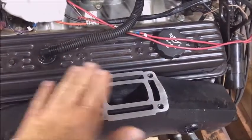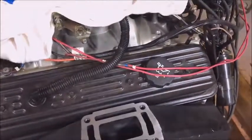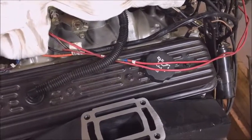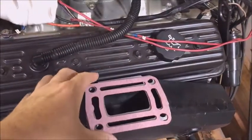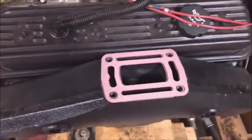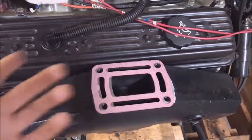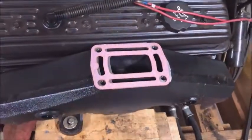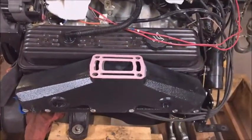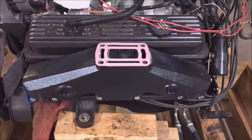It's getting filed down or sanded off so that it's an even surface. When we put these gaskets on, there's no seal or anything between — it's just these gaskets and they get torqued down to 30 pounds of pressure. You don't want it to leak, because you've got water that comes through here and exhaust. If you have a leak, you could blow the engine or get water ingestion.